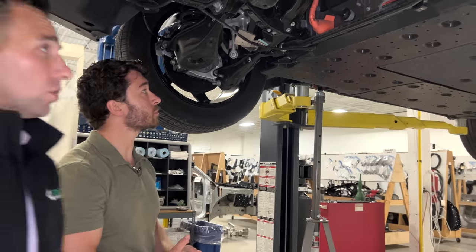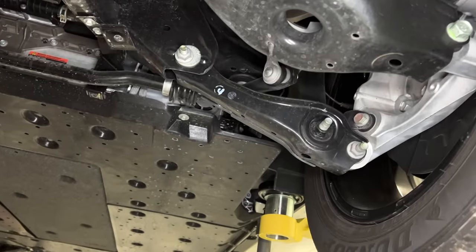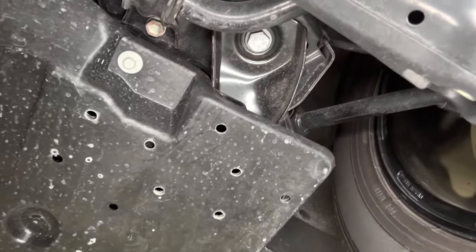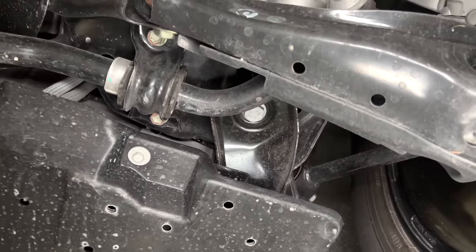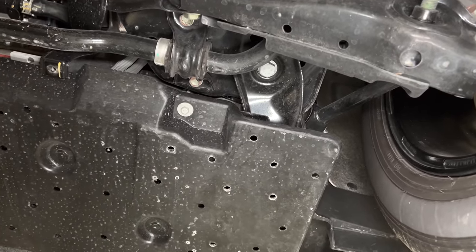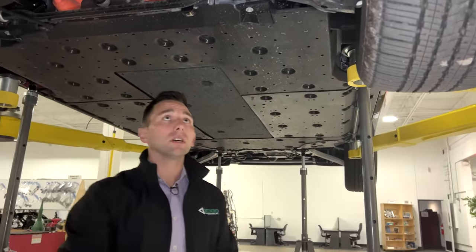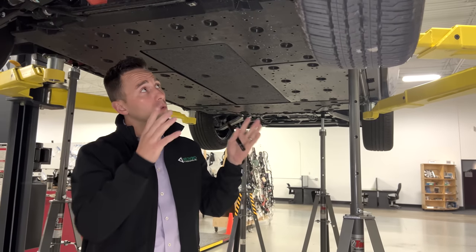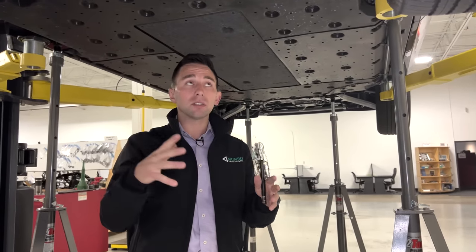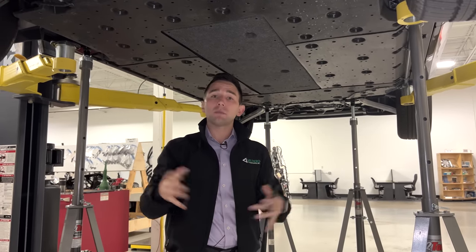The only thing that I was looking at from a structures perspective in connection to the battery pack is once again the double shear brackets. These stampings right here, with this bolt right there, are making a structural connection to the battery pack. In a passenger car like this, a two-row CUV SUV crossover style vehicle, just like a Model Y in terms of size, when you get to this area of the vehicle fore-aft, you've got a second row seat. The pan often has a kick up, but your battery wants to run as far fore-aft as you can manage in order to contain the maximum amount of energy.